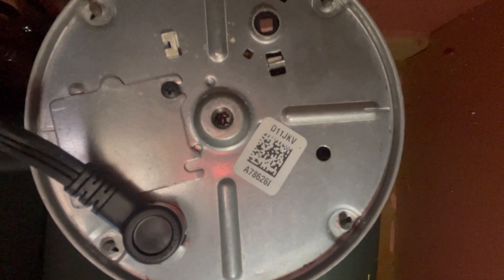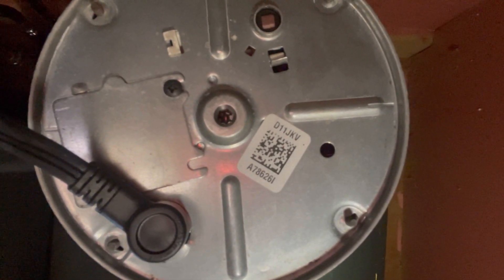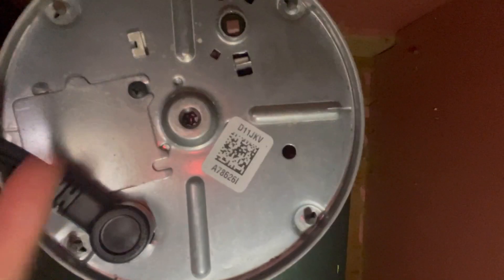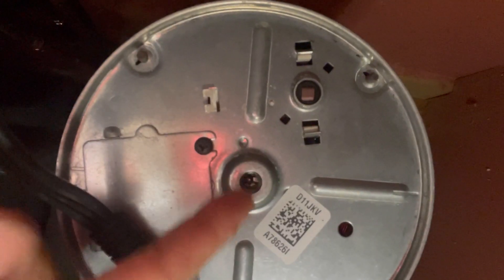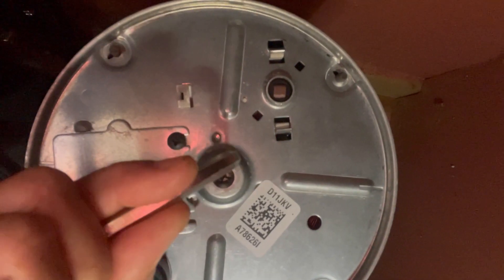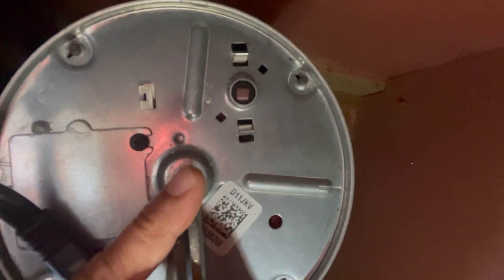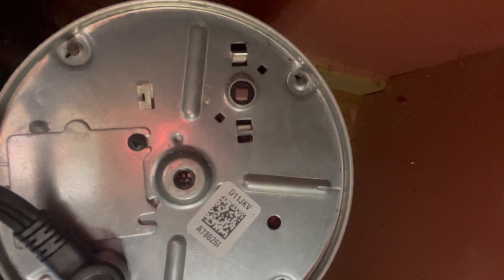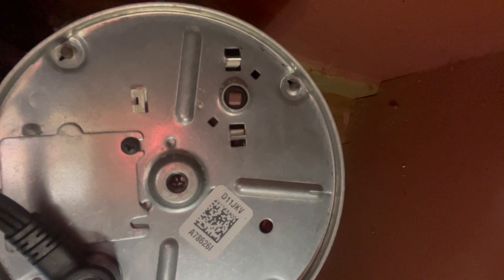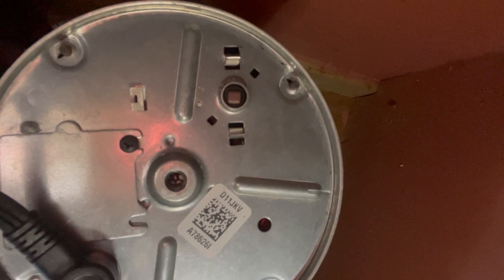If you can see the hole in the center of this machine, that's what we need to fix. Most of the time, the reason it won't spin is because when we wash our plates, dirt accumulates and gets stacked on the side of the machine. Or if you have an aquarium and you clean it in the sink, rocks get stacked inside and it won't spin. So get an Allen wrench, insert it in the center, and turn it — you'll feel resistance when you turn it. If it's hard to turn, perfect.